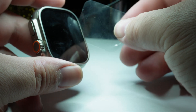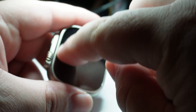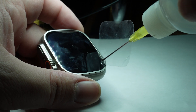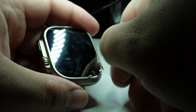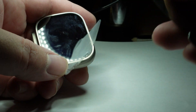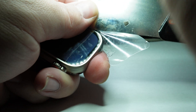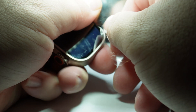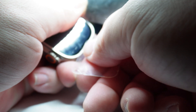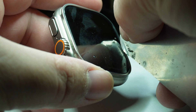You'll actually see that the depth of it goes quite far in. The only place you really have to be careful is on this side because there's a flex cable for the display. We're also working with an extremely expensive display — hundreds of dollars if you make a mistake here, so not necessarily the easiest thing to work with. We'll get our pry tool back out so we can get some leverage, push it down in there, give it a little bit of tension. This will loosen up the ability of the plastic to slide a little bit as we come around the corner and slice down the side.